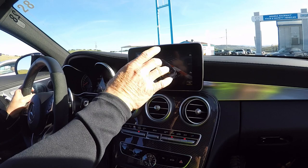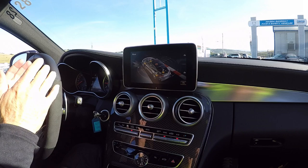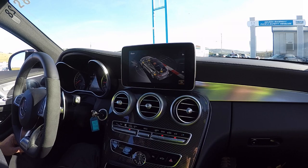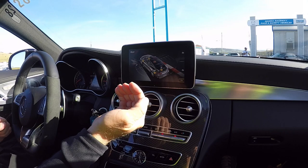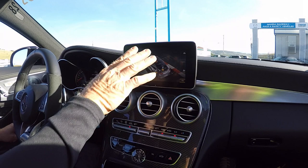When you drive, you can have the friction circle displayed. The friction circle shows you the lateral movement of the car. It's kind of hard to show on the wet skid pad, but on the big track you could see all the lateral movement. When you make the Andretti hairpin and accelerate, you'll see the friction ball come back; when you brake, you'll see where the load transfer is on the car.